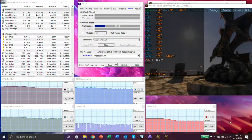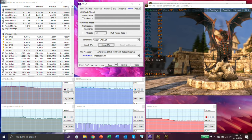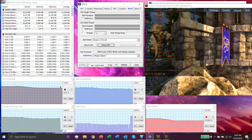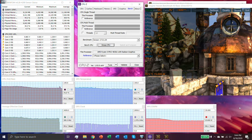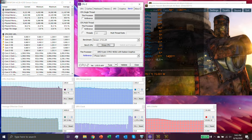Exterior temperatures were just as good, with the keyboard deck and palm rest staying warm at most, with the only real hotspot being the area directly above the exhaust vent. The fan was really quiet, even during the stress test. To test the power-sharing algorithm further, we stopped stressing the CPU — and the 4650U still maintains a 15-watt TDP, but it significantly downclocked its CPU cores to about 1.4GHz to give the Vega 6 room to stretch its legs, maintaining its full boost clock of 1,500 MHz. This is accompanied by a massive framerate increase in the benchmark from about 30 to 50 FPS.